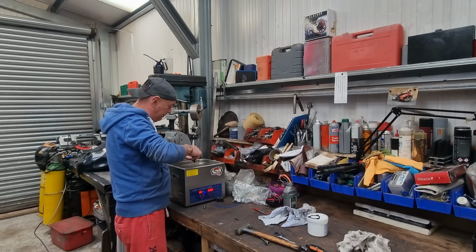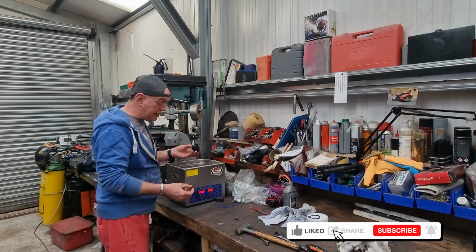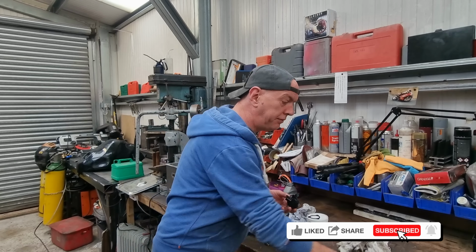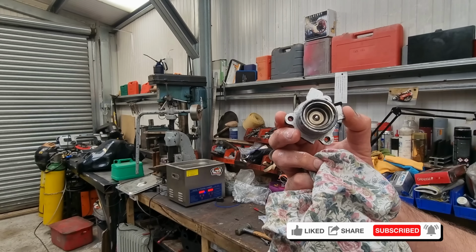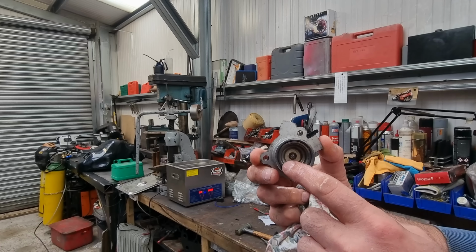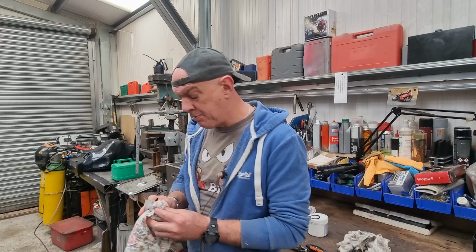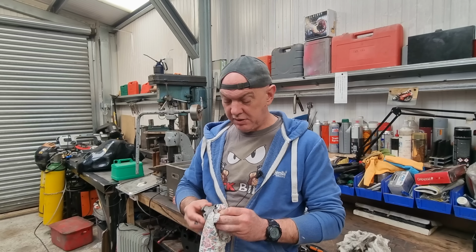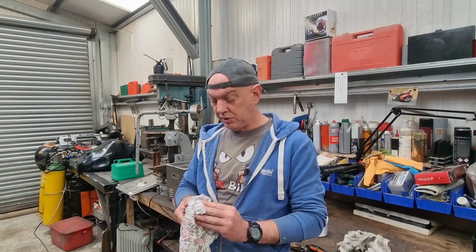I'm playing. I wasn't happy with the clutch. So I've had the clutch slave cylinder off, which is this jobby, and there really isn't anything to it at all. Sits up in there, that's the piston. There is a seal that sits around there and a spring behind it. That's it. I have got another service kit coming, just because there's something a bit iffy with this, and I just want to make sure it's all as it should be, sort of thing.